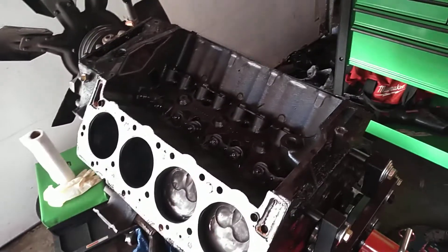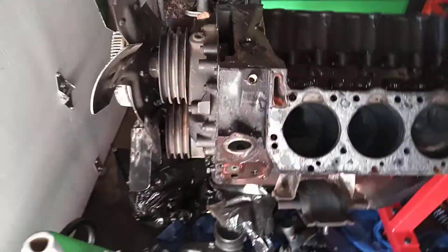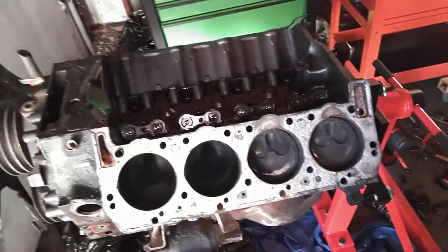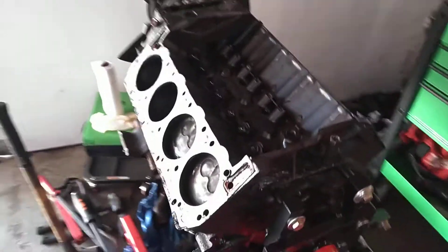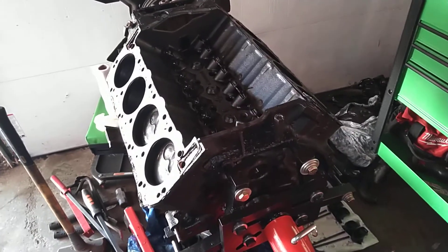I can't tell about the cam yet, but the lifters are really nice, so I figure I'll take the front cover off and do just a basic clean, clean the heads up. Valve springs look good on them too. I know being 30 over on an IDI is not a good thing, but for right now, this is what it is. Talk to you guys later, bye.